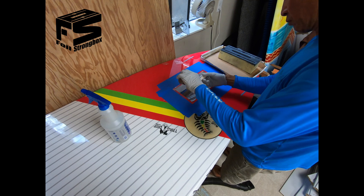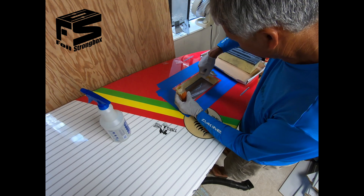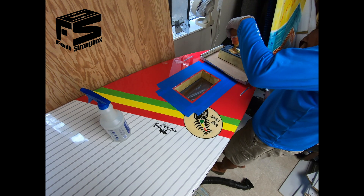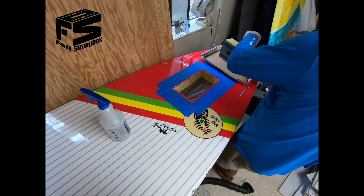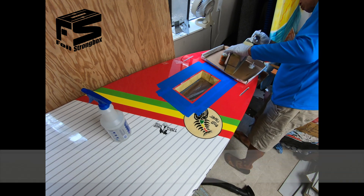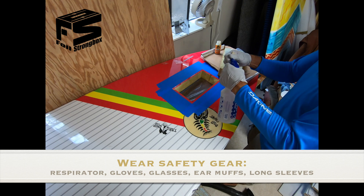When you put the box into the board you've already cut it to the right thickness — exactly the thickness of the board. Double-check that; if it doesn't come out perfect, sand it or recut it so it's perfect and flush on both sides. The minimum thickness you need for the tuttle installation is three and a quarter inches — if it's less than that you might have to make little humps on the deck to compensate. Also important: make sure you wear your safety equipment — glasses, earmuffs, and a respirator or face mask. That's super important.